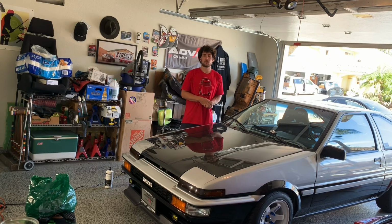Generally, at your average detail shop, when you're getting a paint correction and ceramic coating, you're usually getting a one or two-step correction. On a one-step correction, some shops call this a gloss enhancement. For me, I call it a 50% improvement, or up to, which means I'm going to get rid of at least 50% of the swirls and defects in the paint. Usually that's getting rid of the top layer of swirls, but leaving those ridges behind.